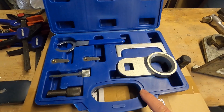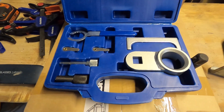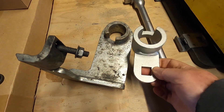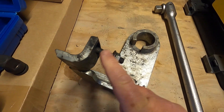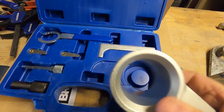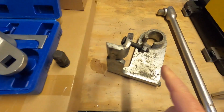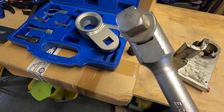Alternatively, because those VW tools are very expensive, you can buy for about 25 pounds a timing tool kit — this is one I got off Amazon. It has a very similar locking tool, but you can see it is a great deal smaller. The official VW one actually locks in place on the bottom of the engine with a bolt and a little arm. This tool slides into the crankshaft pulley — that little notch there fits onto a notch inside the crankshaft pulley to lock it in place.